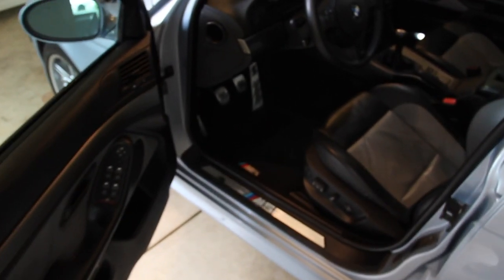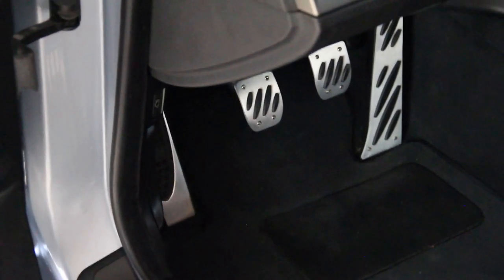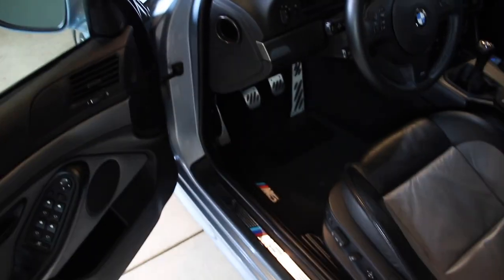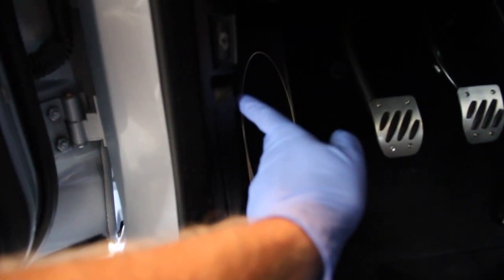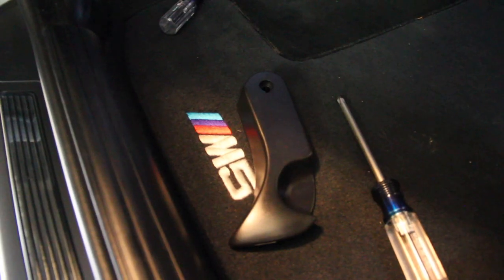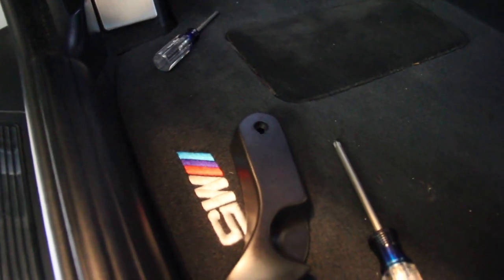We're going to kick things off in the cabin footwell — best to start inside while we're still clean, since taking off the bumper means getting a little greasy and we'll need to jack the car up and remove the wheels. We'll start in the cabin and work outwards towards the latches. The first step is super simple: this is the hood release cable and there's a small Phillips screw at the top holding the handle on. Remove the handle, put the screw somewhere safe — we're going to reuse it.